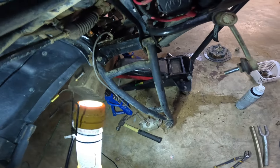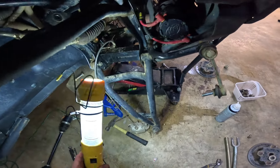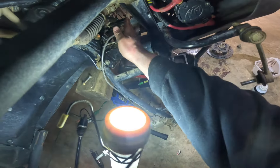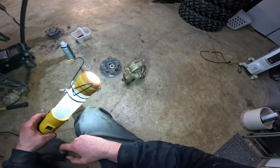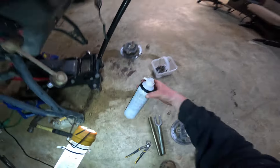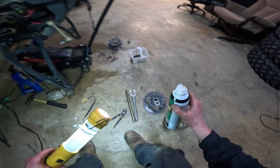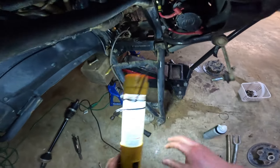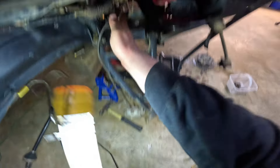The diff is out but the camera wasn't on — go figure. The only difference was after I got the spline out, I chipped this off with a chisel, which just gives you a little bit of extra room. Turn the diff sideways and pull it straight out through the passenger side — there it is, it wasn't hard at all. One little tip: when you go to take this off, it really helps to throw some penetrating oil on it, especially if you ride in water a lot — spray this shaft right here, give it a few minutes, then take it off. Just pop that rivet out with a chisel — it allows it to flex and then the diff comes straight out from this side.